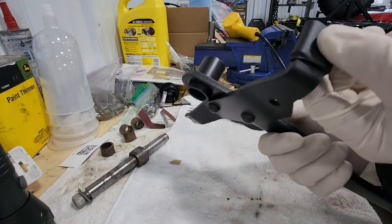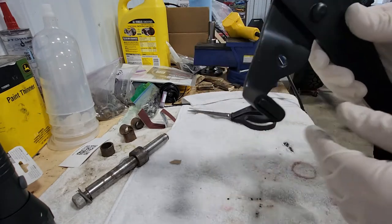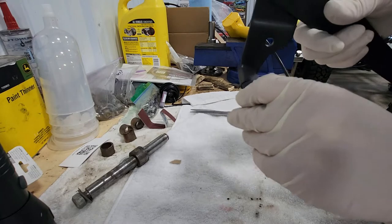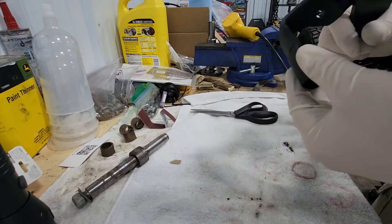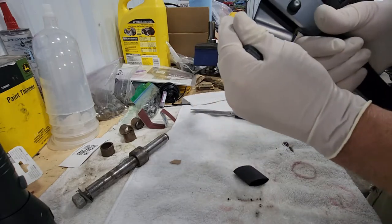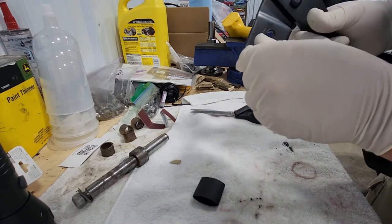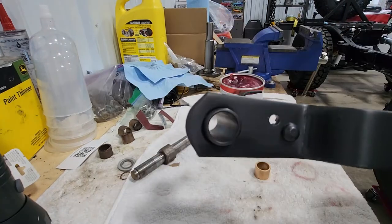I got that cut and slid on, now I'm just going to get the heat gun out, heat that up and shrink it down on there, and see how it looks. Wow, that worked out really nice — it's got a nice wrap on it, nice and tight. This is shrink wrap that's got glue inside of it, so it's going to be bonded to that old bumper. I'd say that's going to work great. I tried a second layer but it doesn't look like that's going to fit.